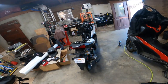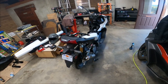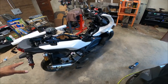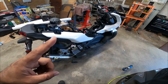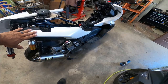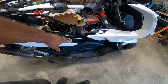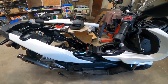First things first, let's give you a quick rundown on what is on your Honda ADV and where specific panels belong and in what order they go in. Looking at the right side of our scooter, they have a very particular order: the rear panel goes in first, then the front panel, then you put in the centerpiece which locks everything down on both sides.